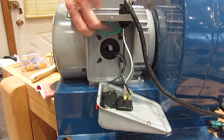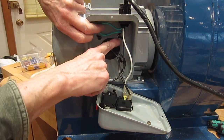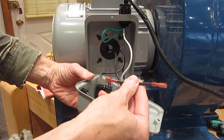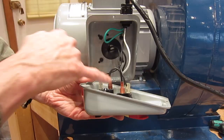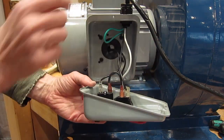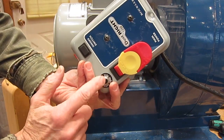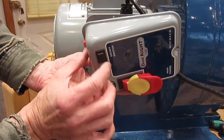Here's the solution: the green wire from the power supply cord goes to the grounding screw as it always did. The hot wire from the power cord goes to the circuit breaker, and I had to create a jumper to go from the circuit breaker to the switch. Then the other side of the switch goes to the motor. The white wire from the power cord goes to the switch, and the other side of that goes to the other lead to the motor. The other switches I left in place so there wouldn't be holes, and I put nuts on the other side of the screws for the same reason.